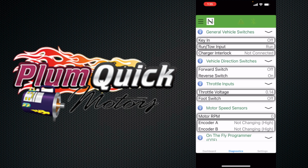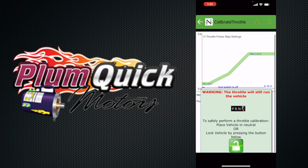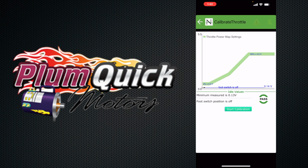You have your throttle inputs. We can go ahead and hit the throttle input. Let's go ahead and calibrate the throttle here. Once you put the golf cart in run mode on the Yamaha, it does not have a neutral, it just has forward or reverse. So you're gonna have to press this green lock button down here to calibrate the throttle. And once you calibrate the throttle here, you can press the accelerator pedal and the cart will not go. So we're gonna hit start calibration.